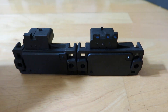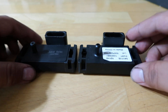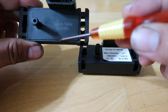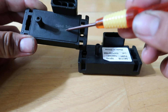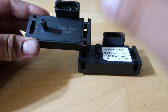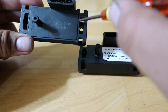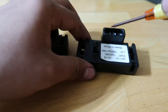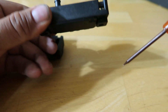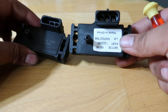From the back side, those are the obvious differences. For the front: on the replica, it has a seam on the front of it as well — it's got a back and a front face pressed or glued into the MAP sensor body, and glue is visible. On the authentic, there is no seam — it's just one solid MAP sensor body. The only seam is on the back, nothing on this side.